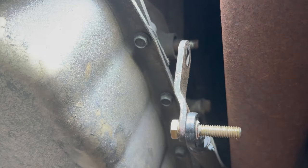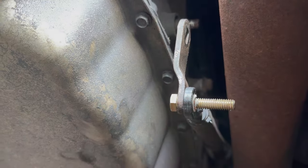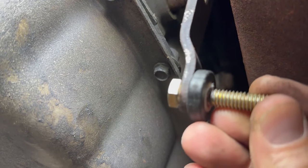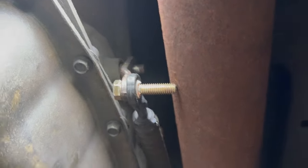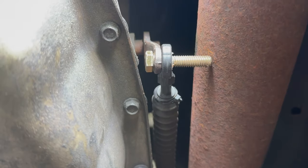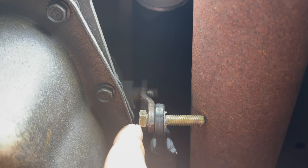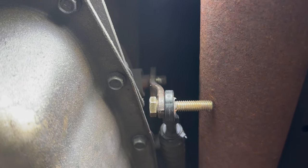Now that I've removed the retention piece of the original nylon bushing, you can see that the bolt I selected — the bottom threads end perfectly — so it's not touching anything inside this bushing and shouldn't have any rubbing issues in the future. I'm going to reinstall the linkage now. This is where I'll really check travel. You have to cut some of this bolt off, so I'm going to mark it and rotate it down to see how close it gets.